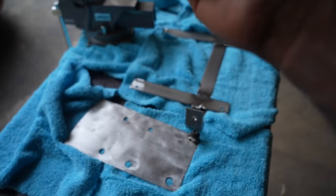And the boost, this is the boost line, and the boost line is the soft one. So you use the soft one, not the hard one, not the nylon one. And you connect the boost soft line right away. I think it's easier for me to just connect it right away. I don't need to wait. I want to have the same length. That's what I'm aiming for. So you get the boost line and you connect it. Just push it in, it should go. Just like that, very easy peasy, straightforward.